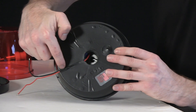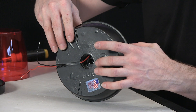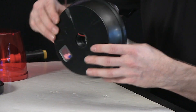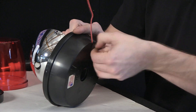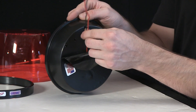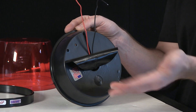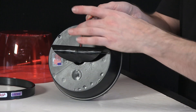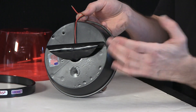On the bottom, it comes out of the package with a side output harness. Integrated in the center is a standard one-inch pipe thread, so if you're not going to flat-mount the beacon, you can thread it onto a pipe fixture. If you're going to do that, there's a sticker covering the base assembly here, so you can actually slowly and carefully peel it away to free up the harness, remove it from its guide channel, and then route it from the center out to the side, depending on how you're going to mount it. The sticker can be removed and goes back in place very easily, and it also covers pre-drilled holes in the base of the unit — those preset holes are where you'd run bolts or screws through to surface-mount it.